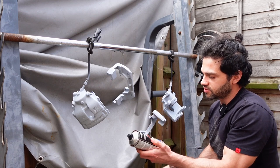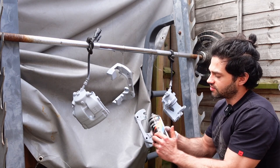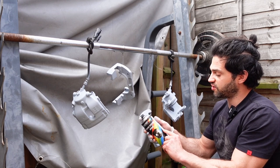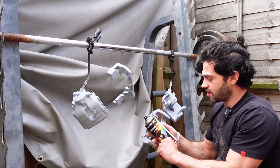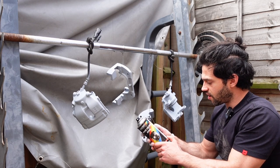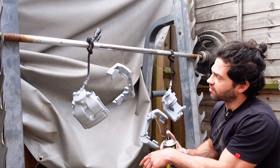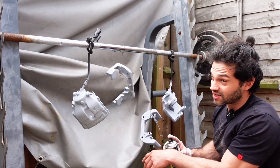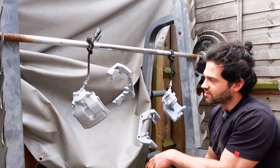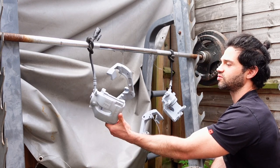Now applying the paint — a multi brake caliper spray in red, shaken for two minutes, sprayed from 25 to 30 centimeters. Processing temperature is 10 to 25 degrees and it hardens after 24 hours. The plan is: one light coat, then a medium coat, then a thick final third coat. I'm not too worried about paint runs or droplets as these are brake calipers and any imperfections will be hardly noticeable.